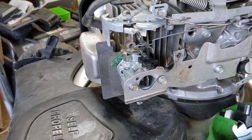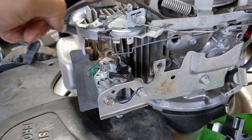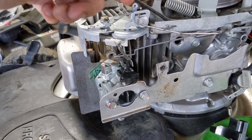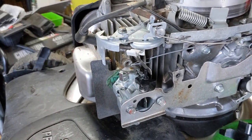I'm going to put all this back together and it should theoretically choke, then I can go up and pull my handle, and slowly it will take the engine off of choke on its own. My customer should be happy that the problem is solved using his original components.